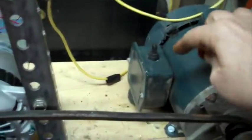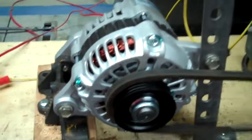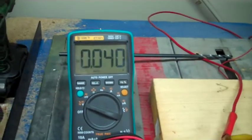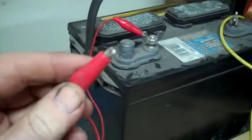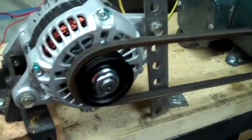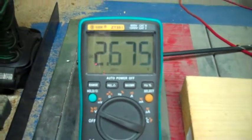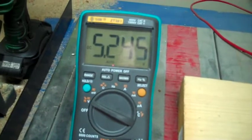The wire from the positive side is not connected to anything, so there's no complete circuit. I turn on my motor — okay, it's spinning right along. I'm reading a little tiny bit of voltage, 0.04. Now if I take this positive wire and hook it up — this thing slowed way down. The alternator just got harder to turn; the belt is sliding. My voltage is going up to 2.6, but it's barely turning right now. If I press to get it turning a little bit faster, my voltage is going up. My contraption just can't get it to spin fast enough to get full voltage.